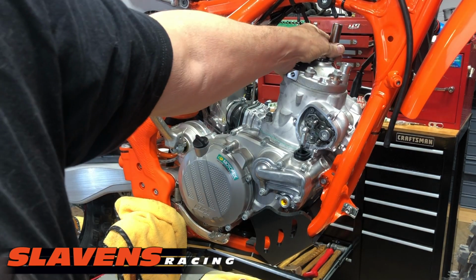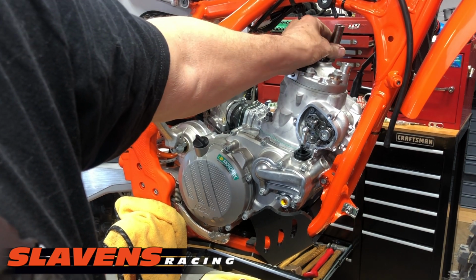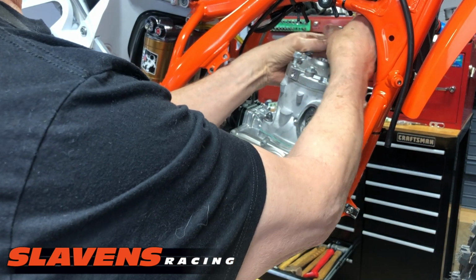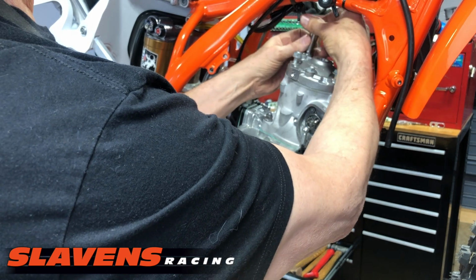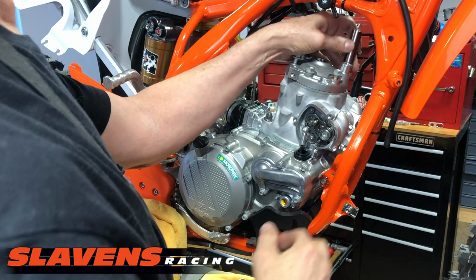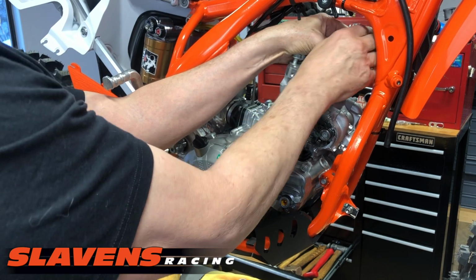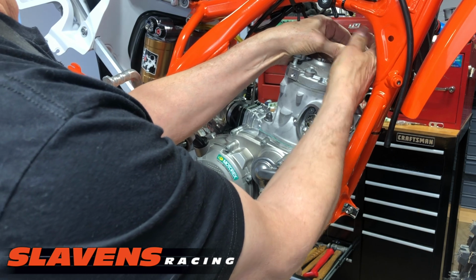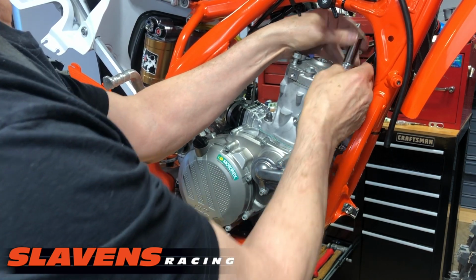Check the camera. Uh-oh. Yep. You want the bolts to go in nice and smoothly. If they don't, then you should get out a tap and clean out the holes in the cylinder and then run a die over the bolt, because you want everything to run smoothly, or bolt down smoothly.